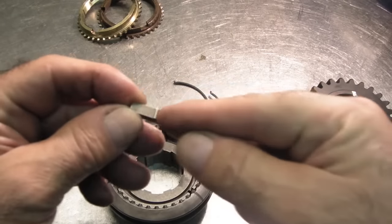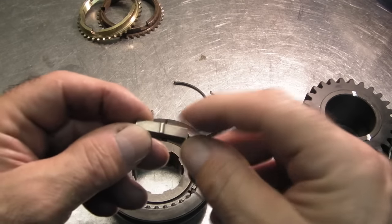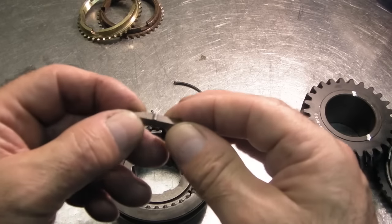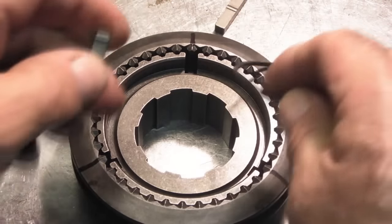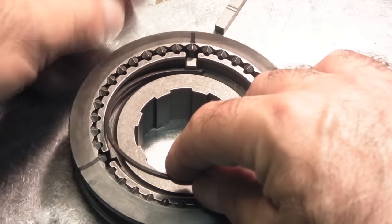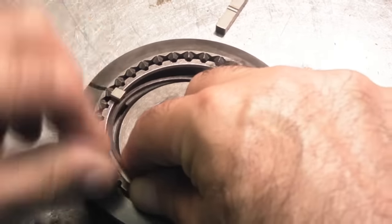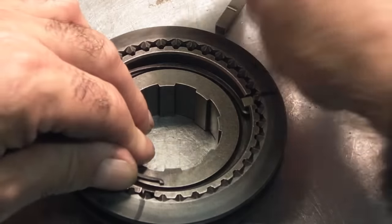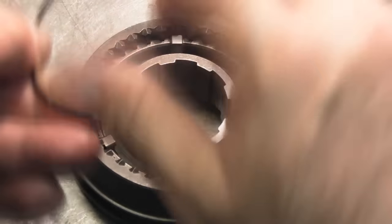Your strut key has a little bump on it. There are many different types of strut keys — some have bigger bumps, smaller bumps; some are made of stamped steel, some are bigger or thinner. Pretty much all synchronizer assemblies are put together the same way. For a Toploader, T10, or Tremec TKO, it all goes the same way.